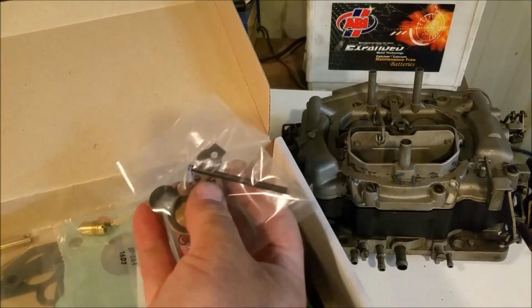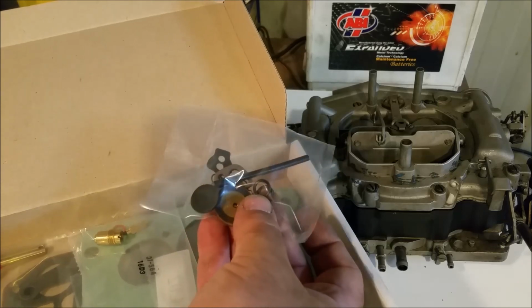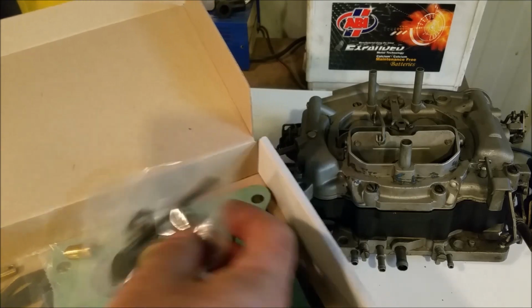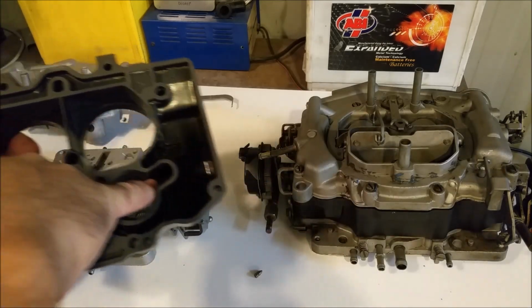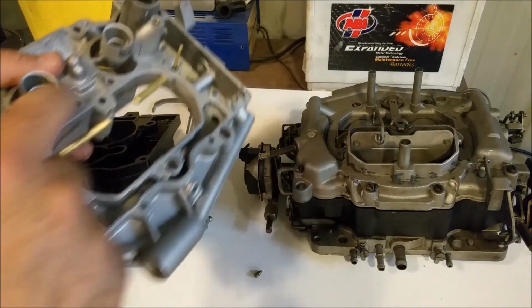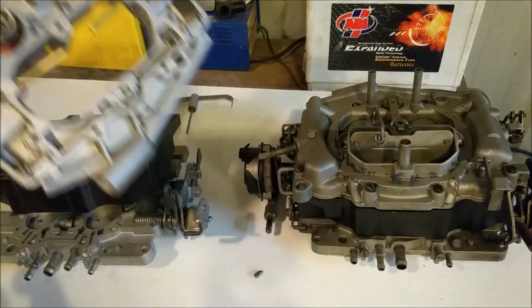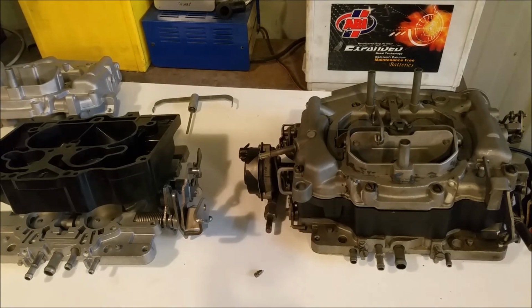A little bag full of tricks, and you need to understand exactly what they do. Now, there are 2 funny looking O-rings there. They've almost got ribs in them, and they're crucial, and I'll show you where they go. They actually drop into these areas here, there and there, and seal off the bottom of these areas, because without those, they don't seal, this thing doesn't work. So there's loads and loads of little odds and ends like that, which you need to be aware of.